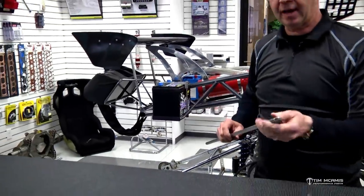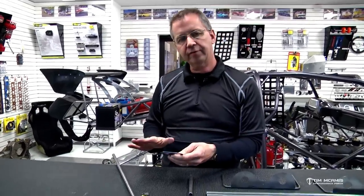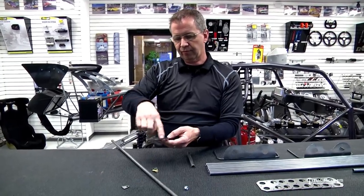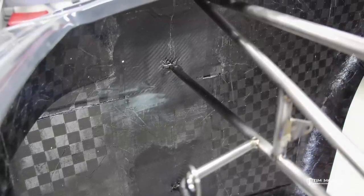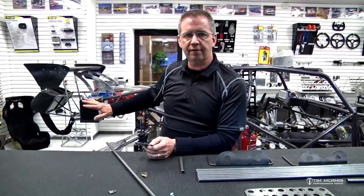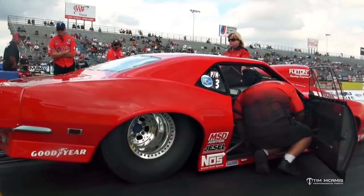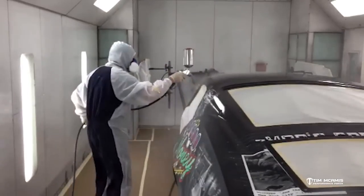Now we've kind of mounted the back of this body and these plates will be permanently attached with the epoxy. But after we've got everything mounted and we've got the body off doing final prep, we're going to grind this surface here, rough up this plate on this side, and then lay some epoxy and some carbon over this, and then a little peel ply on top of that — sandwich that plate in between the carbon and then epoxy on the back of the body. So now we've got this plate securely fastened to the inside of that body and that gives a nice smooth finish on the outside. You have no holes, no warpage from the weld or the tack getting too hot, so your body guy is going to be happy because he's not going to have to work all those spots and try to flatten that out.